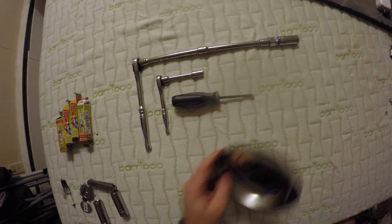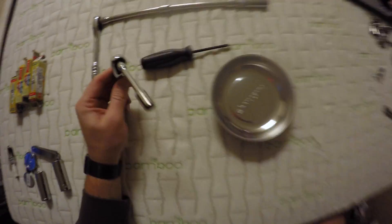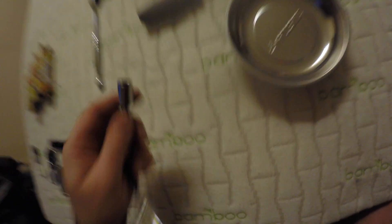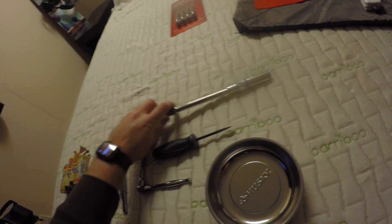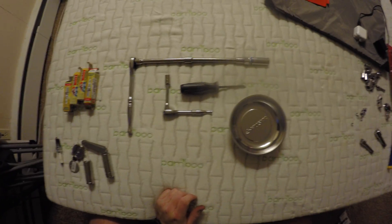Okay, let's get started. We're going to show taking the plugs out of the car, gapping, and then putting the new plugs in. For tools you're going to need a flathead screwdriver for releasing the valve clips, a 3-inch extender and a size 10 socket for releasing the grounding screws, two 6-inch extenders to get all the way down into the bottom of the spark plug, and a 5/8-inch spark plug socket which is magnetic so it's easier to catch the spark plugs. That's basically all you need to get this job done.